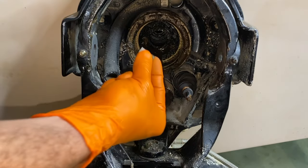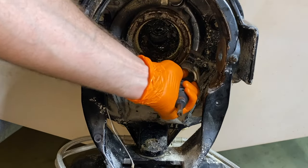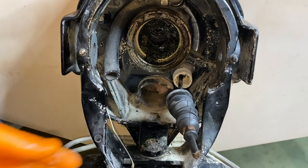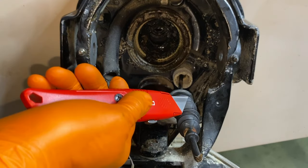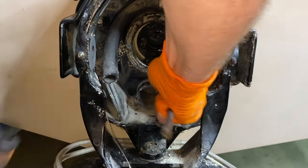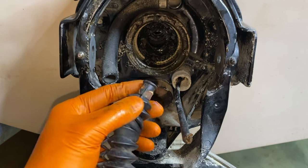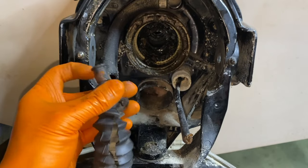Grab the grounding clip — the new bellows will come with a new grounding clip. Set that aside. Pull the shift cable out a bit — the clamp has been loosened enough to pull it all the way off. There's a securing lock here that's tough to remove, so transition back to the utility knife, grab the base end, and just cut the bellow. There is the shift cable bellow — used the utility knife, cut all the way through, made it much easier to remove. No need to salvage it since the new shift cable and bellow assembly kit comes with a brand new clamp.